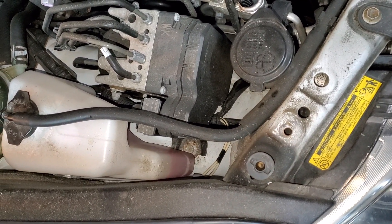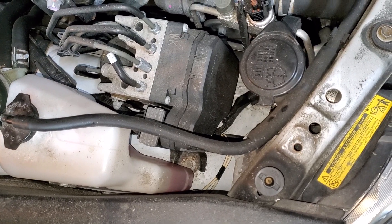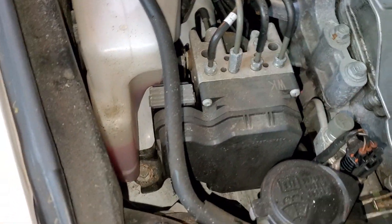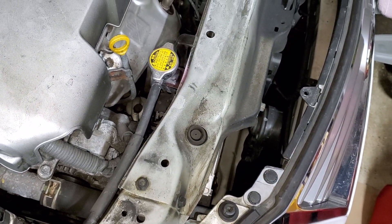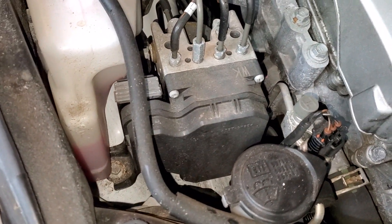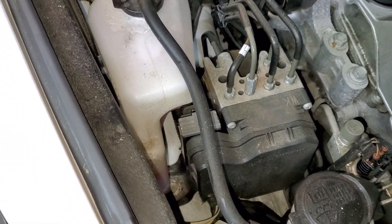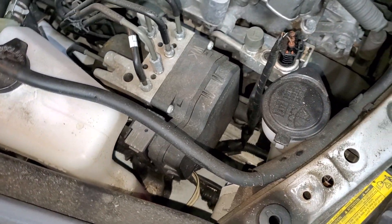Hello and welcome to my channel. Today I'm going to show you guys how to diagnose and find out where your coolant is going. If you look at your expansion tank - and hopefully you do check the level of your expansion tank - usually there is no radiator cap, or if there is it's covered in plastic. I noticed about three months ago that it was low, so I added some coolant and started noticing every other day it was slowly leaking.